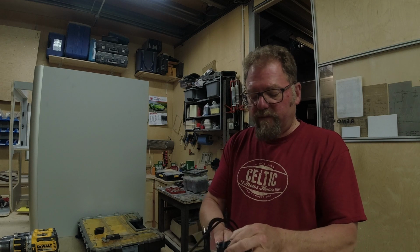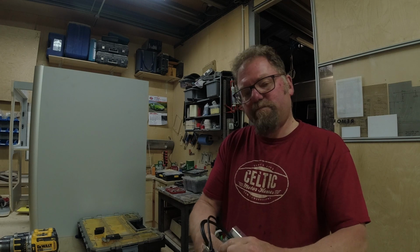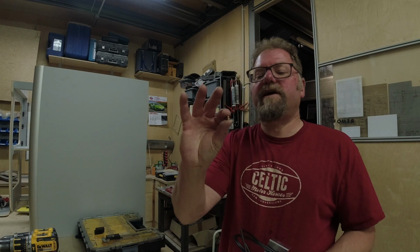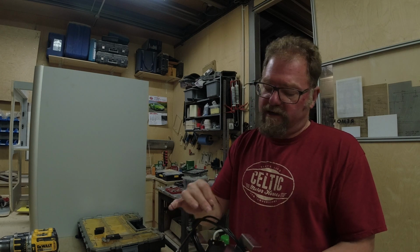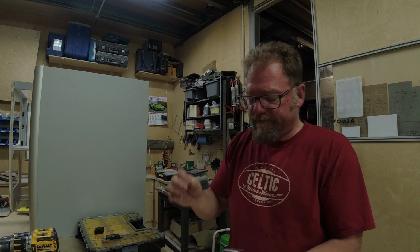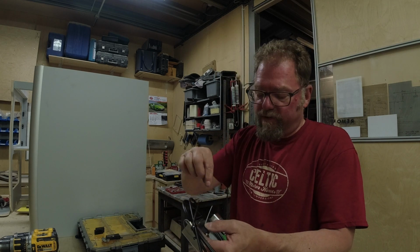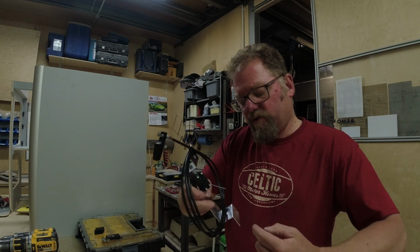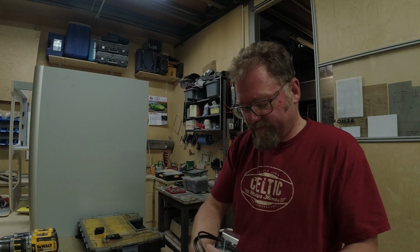There's a block here which will allow you to clamp the cable. It clamps the cable via a solderless nipple which is sandwiched in between and allows access through a keyway with an Allen key. This is bolted together and it will also clamp the existing door handle nipple which will be located in this slot once it's in place.